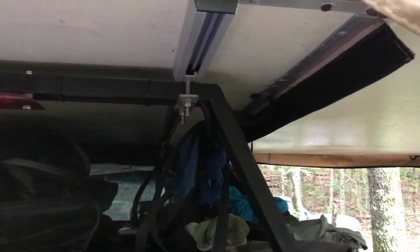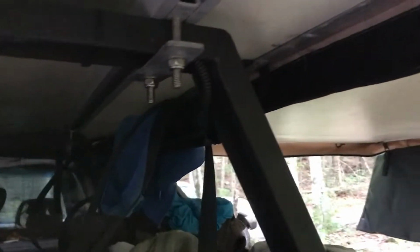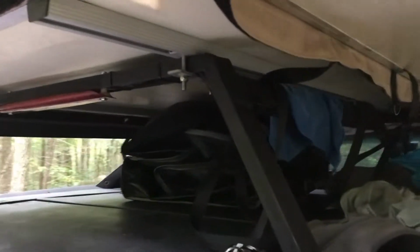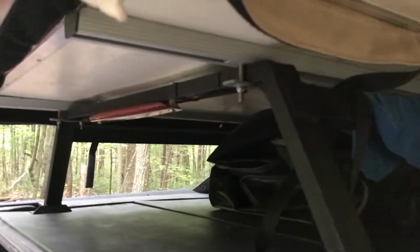As for mounting, the tent simply uses 2 aluminum channels with slides that have long bolts through them and nylocks, and then a bar, or a retaining bar. One of the big mistakes people will make is they'll over tighten these and they'll bend that bar. You have to remember, when it comes to tension mounts, is you want it to be just tight enough to hold it and not over tighten it. Otherwise you actually end up losing the tension you should have.